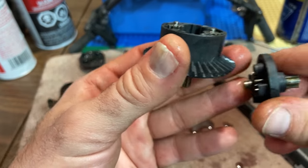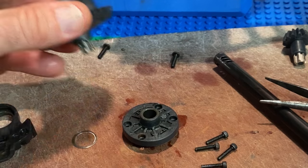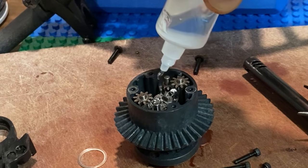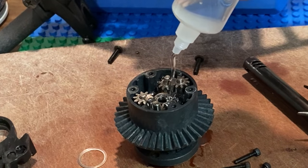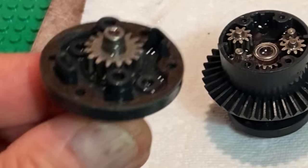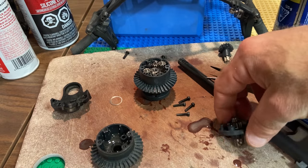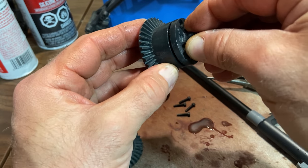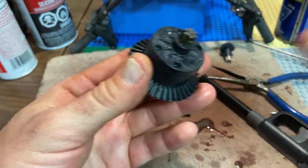I'm doing a dry fit first just to make sure it all goes together. Now it's time to fill it with oil — we're using 20,000 weight. Stock from Arrma is 10,000, but the local hobby shop only had 20,000. I ran it and it feels great — I don't think it's a big difference. Fill it up to just clear that main bearing in the middle. Also important: don't forget the gasket — it blends in because it's very dark in color, and without it the diff will leak. Now you can tell the diff is working — the two out-drives oppose one another in direction.